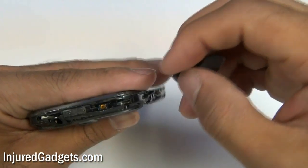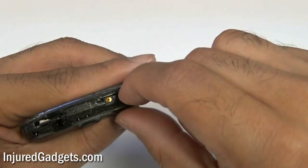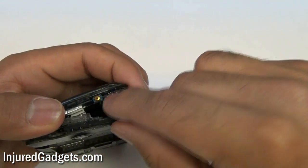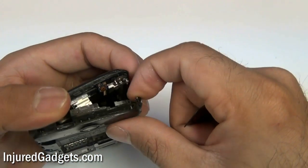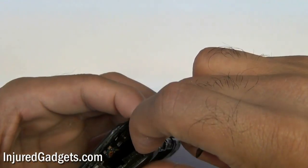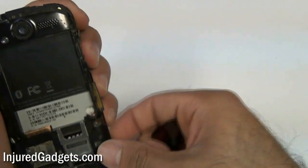In addition, the power cable shown right here — you want to be very careful with that. You don't want to pull the back housing off and rip that power cable out, so go ahead and after you remove the back housing, just pull that cable out from under the board. You can use a flathead screwdriver if you can't use your fingernails, but be very careful when removing that.